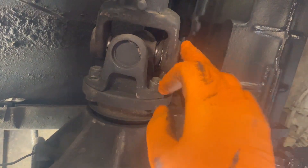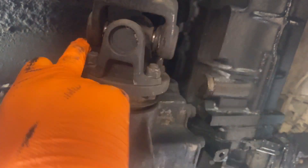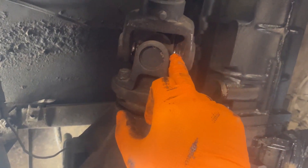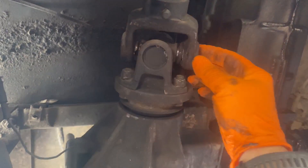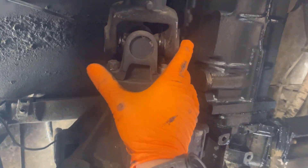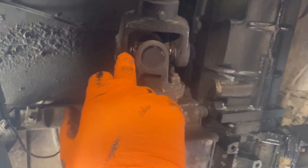Okay so this is what we're dealing with here. This universal joint is completely worn through. I did grease this shaft before I went, so it must be that there's been a lot of dust from those trails — it's got into there, dried the grease out and caused it to overheat, which has broken the metal. That's what's causing the shake, the violent vibration in the car, and a lot of clunky noises.